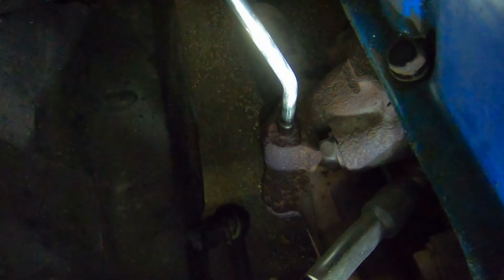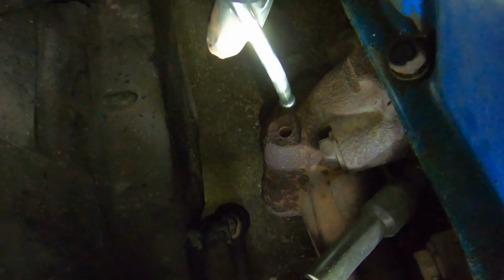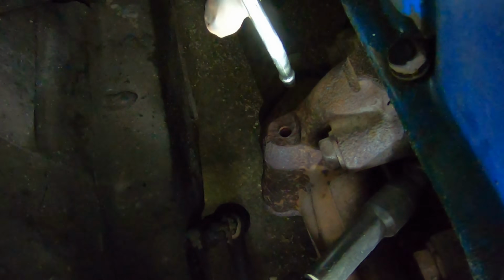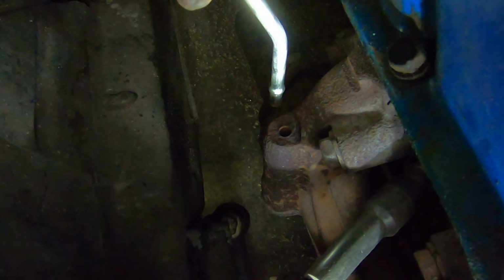These new tubes are going to be pretty tight. I mean, it's going in, but it probably wouldn't hurt just to take your drill and bore it out just slightly. You don't want it to be too loose. You want to be really careful when you do this, but at the same time, I don't want to have to hammer in this new tube, but she's really close.